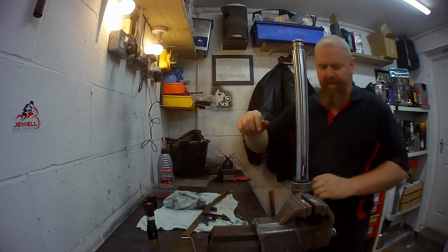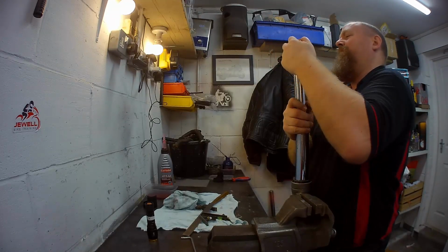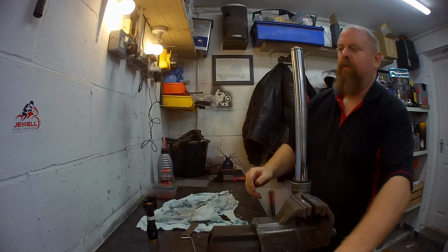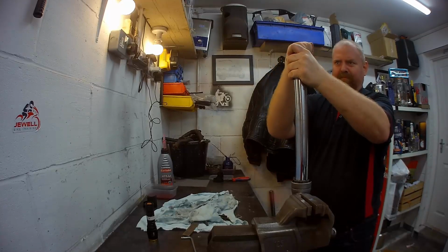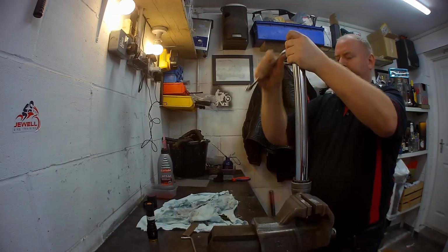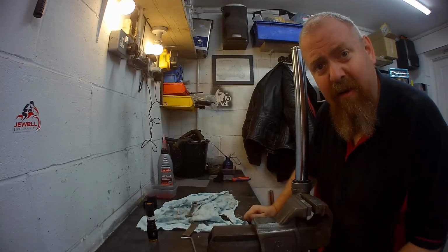Goes in there. Right, push and turn. Thanking you. This is where you realise you've cross-threaded it and you're in for a world of pain. Or it's just on the seal and it's fine. So let's just make sure that is correct and we'll be good to go. Okay folks, that's how to do your fork seals.